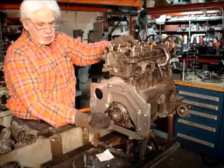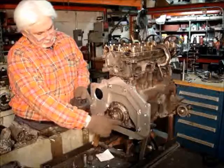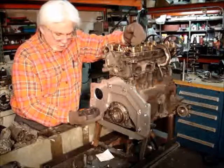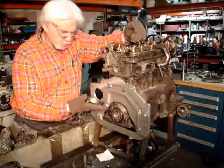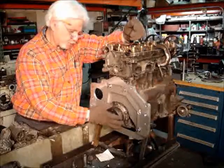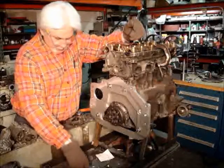Then I was real worried about having that outer circle exactly the same as the outer circle of the flywheel, and I was trying to capture strength in there. Well, I couldn't capture any strength in there, and all it was for was to provide a guide to center. So I put about 1/1000th in there so that this thing just slides on there and sits.